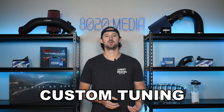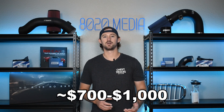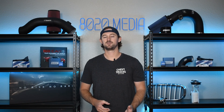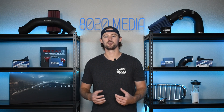Ultimately, getting custom tuning — more specifically custom tuning made for E85 fueling — is going to be the best modification and the biggest power gains that you can get on the 4.3 engine. It's typically going to run you anywhere from $1,000 to get all of the hardware and custom tuning software needed to do this to your truck. It is one of the more expensive things, but it has the best power gains out of anything on our list and is the building block for all of the other upgrades we're going to talk about.